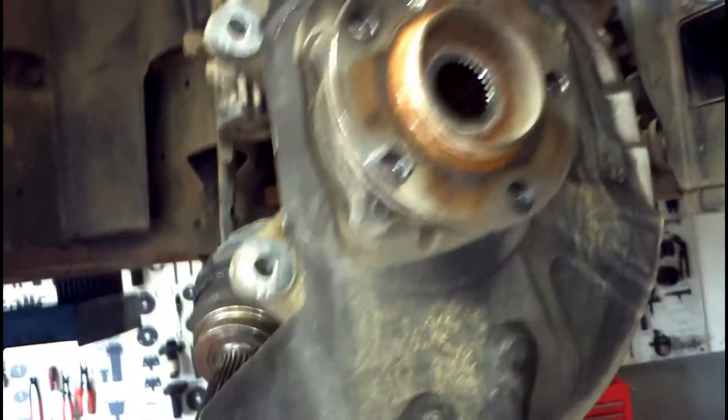After that, I pulled out the whole hub and the shaft came out. I also moved this section of the strut — this camber arm — out so that the shaft will fall out the centre, as you can see. You can see where it's been leaking. Around the diff side, there is a special tool for this but I found it useless. So what I used was my sledge and pry bar, which is a great combination — basically just pull that straight out. It's got a circlip on the inside. I've got a drip tray ready just in case it makes a bit of a mess with the diff oil.